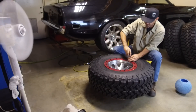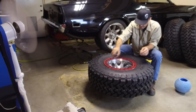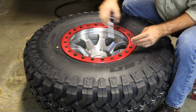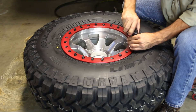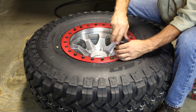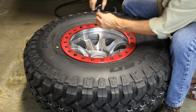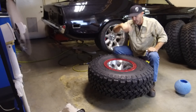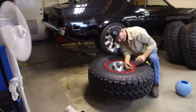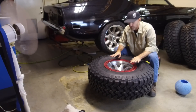I'm just gonna continue to buzz these down finger tight. Get used to this pattern because it's now time to just chase this tightening sequence around the rim, which will probably seem like a million times. Now that we've got our first round basically finger tight, there's a nice even gap underneath here — that's the rubber in between that lip — and eventually what we want to do is see that disappear and this pull all the way down to the aluminum.